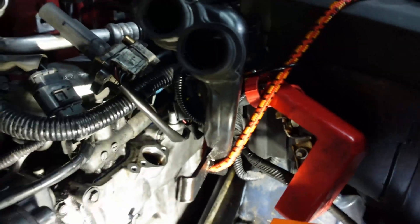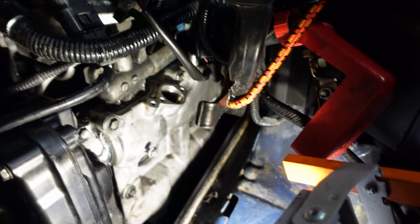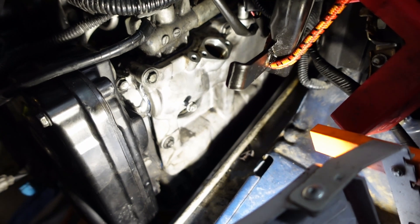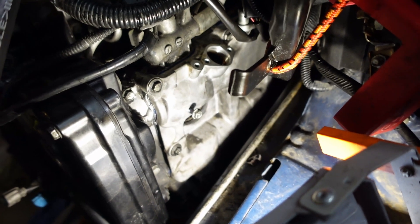Camera died, but I got it in — that's the good news. It's just so tight in there; you really just got to move all these hoses and wire harnesses out of the way, but it will fit. Be very careful when putting it in that you don't disrupt the gasket — it's really easy to get caught on the cams and pull it off. Once it's on, confirm that you can see the gasket visibly from the outside when the valve cover is mated up against the head. What helped me was putting a bolt in to keep it in place, then getting under the car to double-check the gasket was all around, and if needed using a small screwdriver to pry the valve cover slightly away from the head and push the gasket back in. We're going to let the RTV dry a little bit before we torque it down to spec.